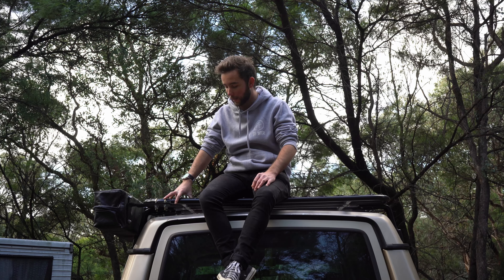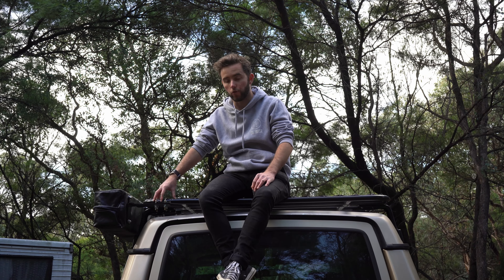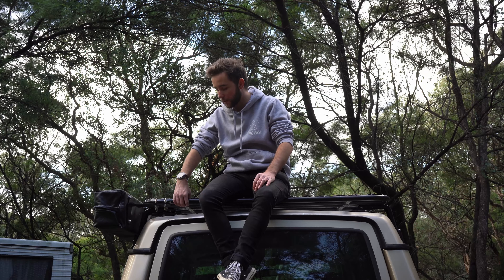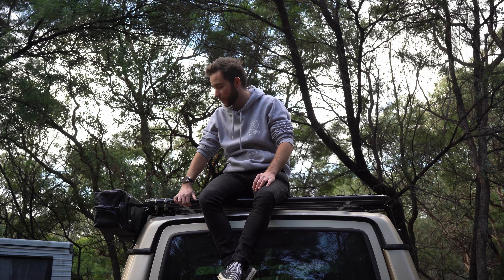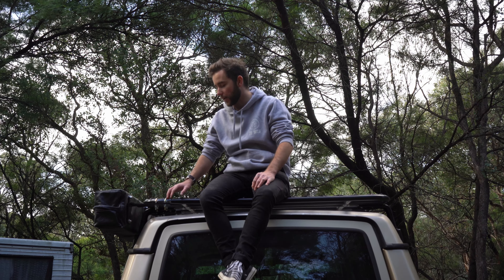When installing this I did run into some issues with the Ocam roof rack in terms of mounting anything heavy like an awning. I mounted it to the tube because that's obviously the strongest part, but the tube is alloy so it bent pretty easily. I over-tightened it and got some bending in pretty much all of the pipes I mounted to, which is a shame.